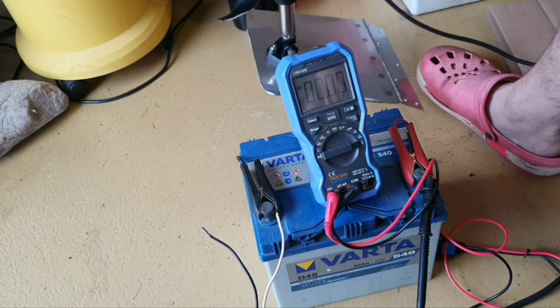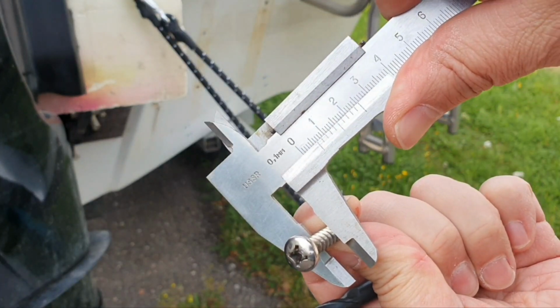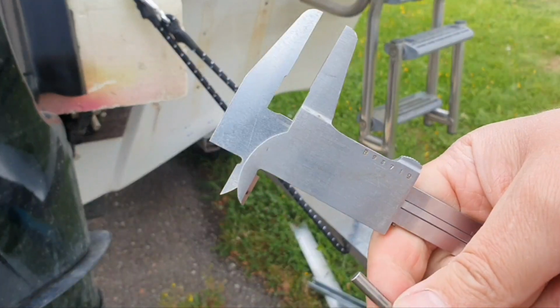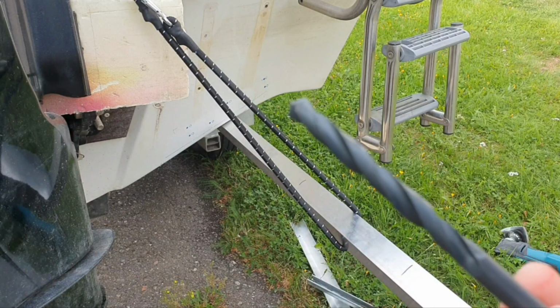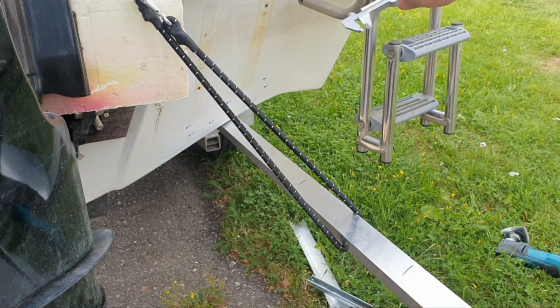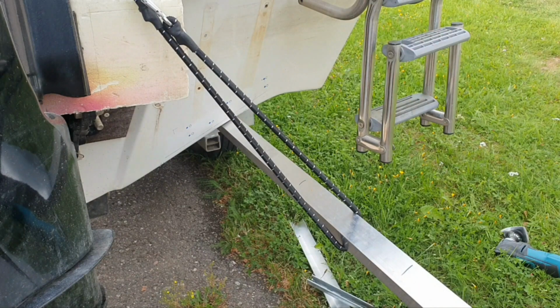I want now to try on the board when it's fully opened. Okay, they have this screw, and when I check, it's 6.2 for me. They ask for a 4.8 drill. I have 4.5, which is maybe 4.6 millimeters, something like that. This should be fine. And then I use an 8 to open more space at the beginning to avoid cracks on the surface. In the very beginning I will use a really small drill because I want to be exactly in the center of the holes.